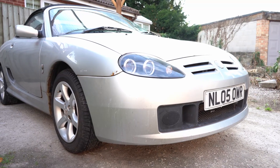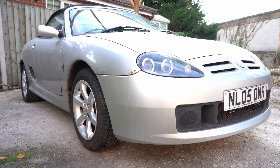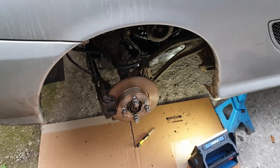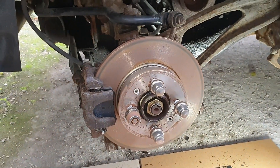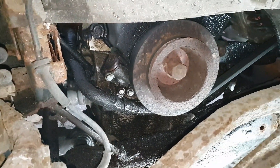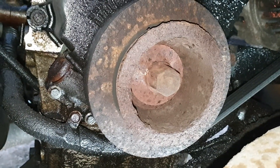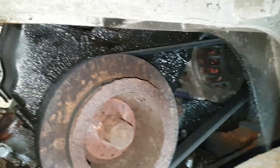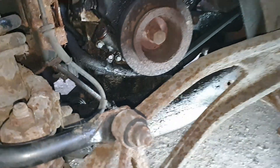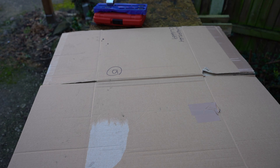Hello and welcome back to the channel. This past week I've been cracking on with replacing the head gasket on the MG, and I've gotten as far as the crank bolt pulley. I've been struggling to get this off - tried the conventional way with a socket, breaker bar, and extensions, but as you move it, it turns the engine around. Even with somebody standing on the brakes and putting it in fifth gear, it's still turning - the brakes aren't going to be that effective anyway because it's got new discs and pads on. As you can see, the whole car is pretty rusty underneath.